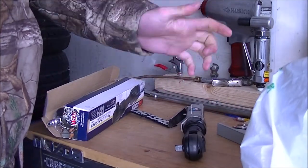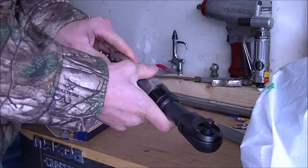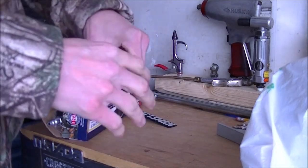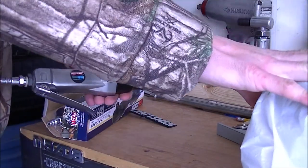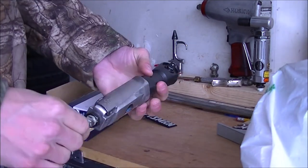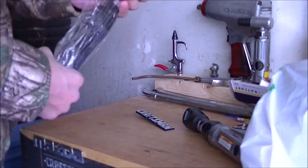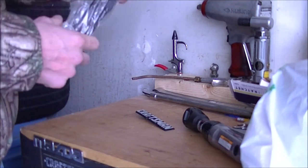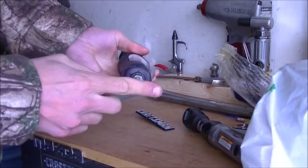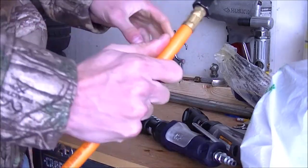All right, it is really cold outside. I also have an old Craftsman air ratchet here for comparison. I'm going to put a nut in and torque it down to about 50 foot-pounds to see if this will come apart. The first thing to do with any new air tool — Campbell Hausfeld or otherwise — is to put oil in the inlet before you run it. I'm grabbing the air hose to plug it in.